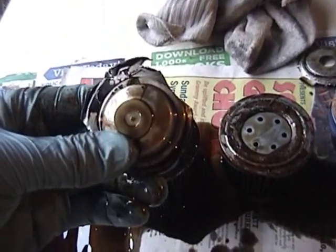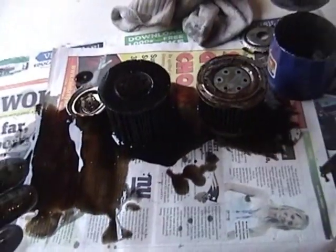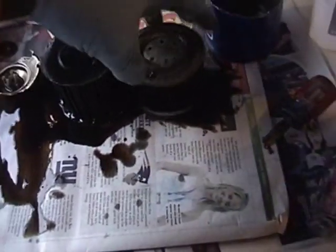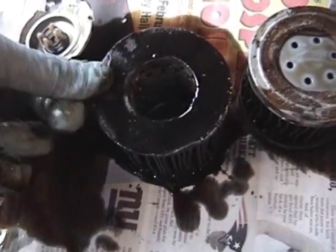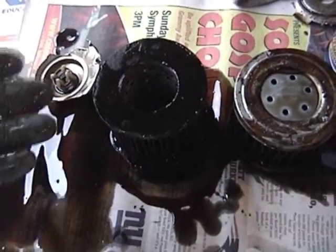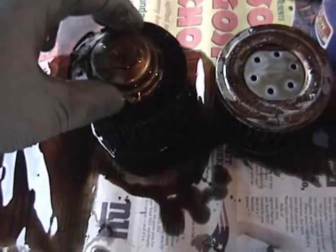The Fram filter does have this little check valve here in the bottom, which I guess is to relieve oil pressure if the pressure got too high. There's nothing like that at all in the STP filter. It's possible the STP filter has better filtration capacity, although the element in the Fram filter is definitely taller. There are metal end caps here on the STP filter, and it's possible that the end cap on the Fram is actually cardboard. I don't know that that would ever cause any sort of a problem, because there was this metal layer on the bottom with the check valve, not to mention both of them have the metal can around them.